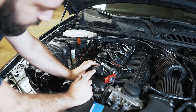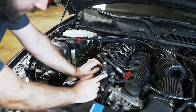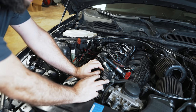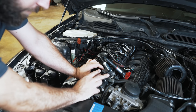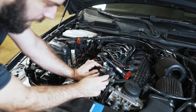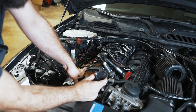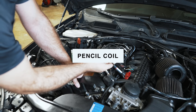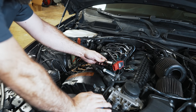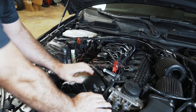What BMW did with the B58 coils is they still draw power from the ECU - there are still only three pins. BMW prefers to have full control with zero latency, so you can drive the ECU directly to the coil. The response is really quick, you can detect a misfire, and the ECU is in full control. But you need a large internal coil section to store a lot of power. These B58 coils are supposed to deliver twice as much energy as your original pencil-style coil. The Audi coils were better than stock but had a couple of drawbacks - mainly signal conversion latency, so you may not be able to detect a misfire instantaneously.